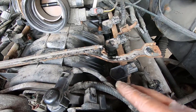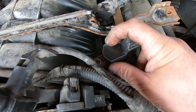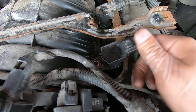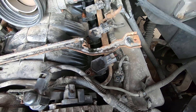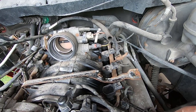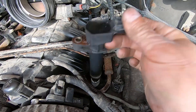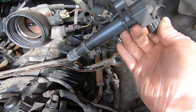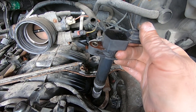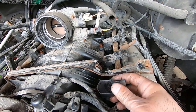After you get the nut loose and disconnect the connector, you're going to pull up on this coil pack. You might want to use a little persuasion — they can be stuck in there a little bit. What I did is I persuaded a little bit with this pry bar, just eased it all the way around, because it is made out of plastic. Then pop it out — that's what it's going to look like. You're just going to do the reverse: drop the new one in, bolt it back up, and plug it back in. You're going to end up doing that to all eight.